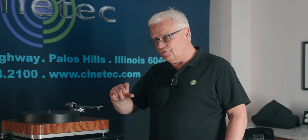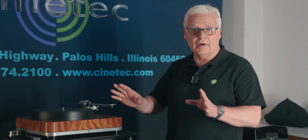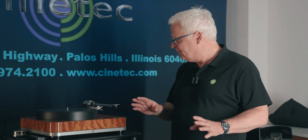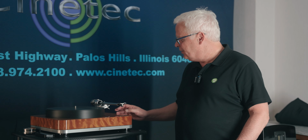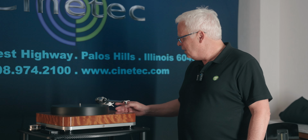but it's not just whipping around. It just turns very precisely. Because of that, once you get it to the exact tracking weight you want, you just leave it. There's no grub screw or anything. It's very simple but very effective. The other thing is the anti-skating. It's done a little bit differently than some of the other brands, but it's very effective